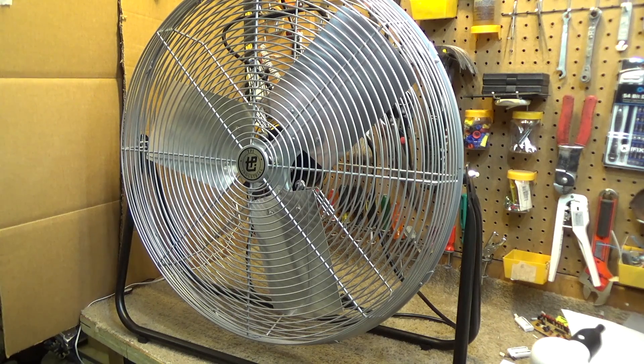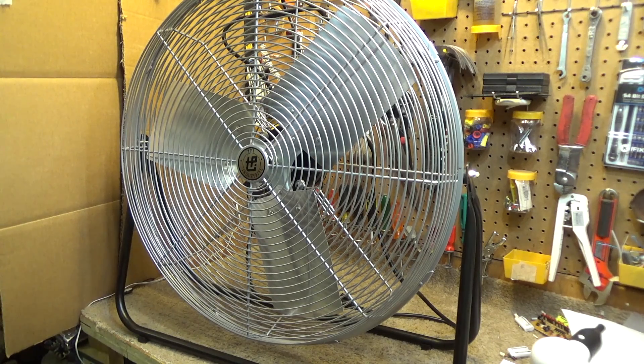So if it was 90 or 100 degrees, or I was using this outside, the motor would be upwards of 180 to 190. The thermal fuse usually cuts off at around 230, so I think that's a bit too high. I recall the 12 and 18-inch models running pretty hot as well.